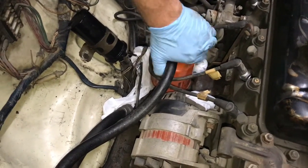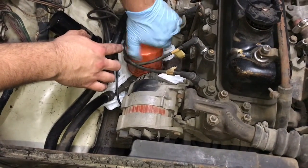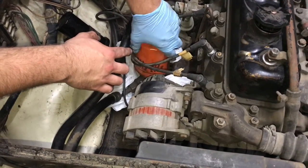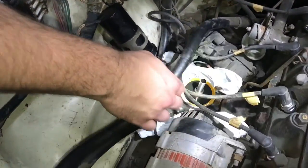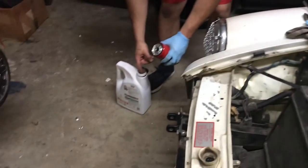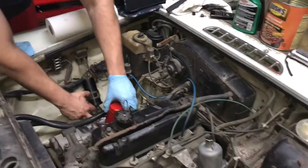Actually in there unless you actually started it up. That's a good point. It might not be, in which case we'd be saved. Yeah, this looks like it's probably a brand new filter. Yep. Well, there's definitely oil in it. It didn't puke out. So it's just pulled up right there. Yeah, we should probably put something behind. Some oil on the gasket. Let's just hand tighten her down.